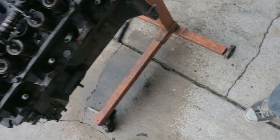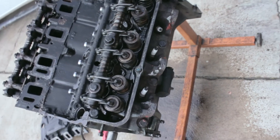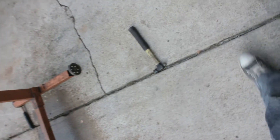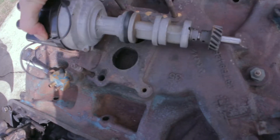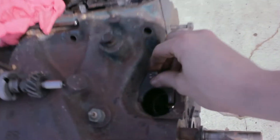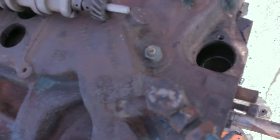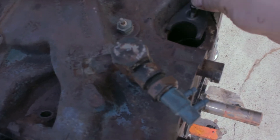The dipstick you can just yank right out of the side. Dad told me to put it somewhere it wouldn't get bent and messed up, so naturally I immediately lost it. Otherwise I'd show you exactly how it pops off — just grab and yank. At this point the distributor would be right down in this hole. It's really easy to take out — you take this bolt off with a retainer plate, and then the distributor just twists and comes right out.